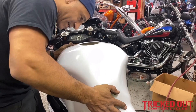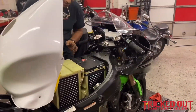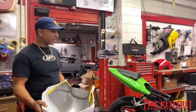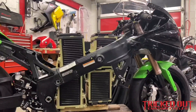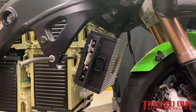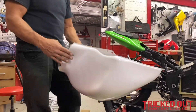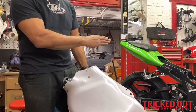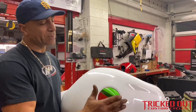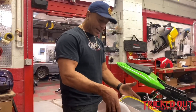I've got the batteries configured exactly where I'm going to mount them. I need to get some hardware to weld up some mounting brackets. I'm utilizing the existing front engine mount to support the batteries and I'm going to lead off of that with some cage work. Now that the tank shell goes on and off, I'm going to shape it a little better, adhere the tank to it, heat-warp it down to follow the body lines of the frame and subframe a lot smoother. Then we'll probably be ready for painting. I'm going to fill in the gas cap or maybe do a custom light-up section there for charging.